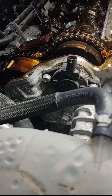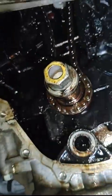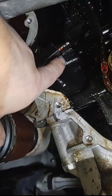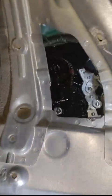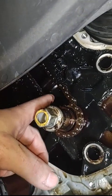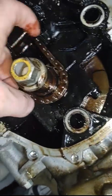I put this nut back in and started spinning it - the thing was just jumping like crazy. It's way off now. If you feel the chain, it's so loose, and the tensioner is all the way out - all the way. It almost moves too easy. It's almost like there should be another guide, or the guides are so worn or the chain so stretched that it's just beyond belief. You can see the timing mark is holding tension on one side but this side is flopping around.